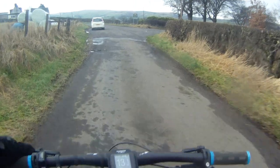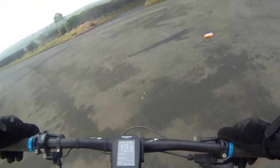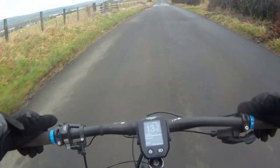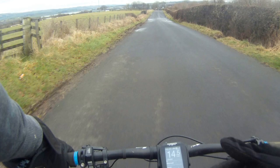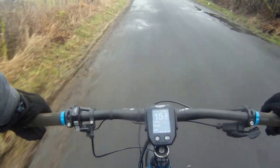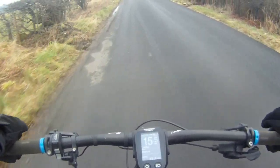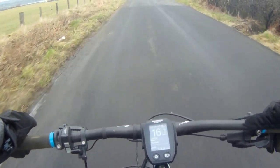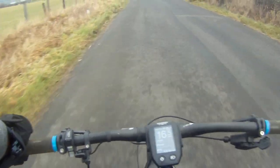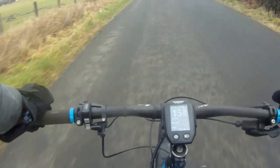Because the bike's driven through the crank, as opposed to the old systems where the power was generated through one of the hubs. So on freewheeling, the bike would be restricted, whereas on the modern bike, the hubs are free moving. So travelling downhill isn't restricted at all. You can feel the motor pulling back a little bit as you get to the maximum speed, but it's quite easy to pedal through it.